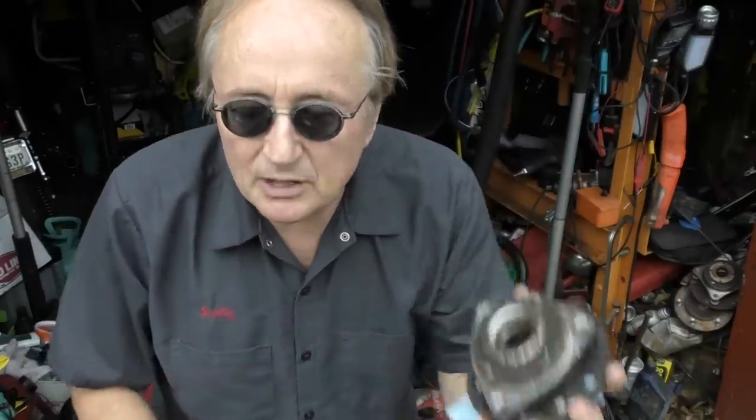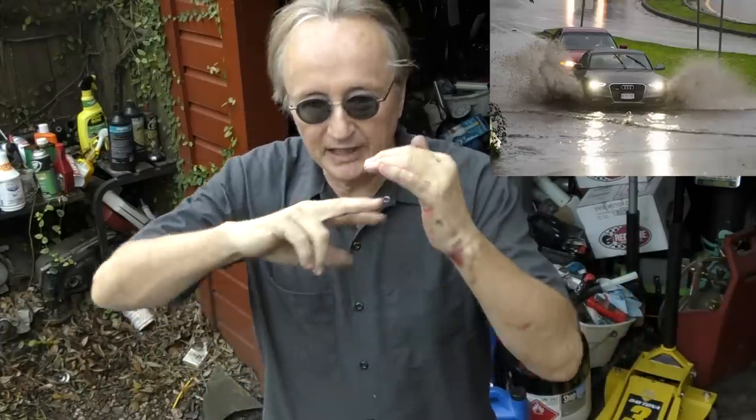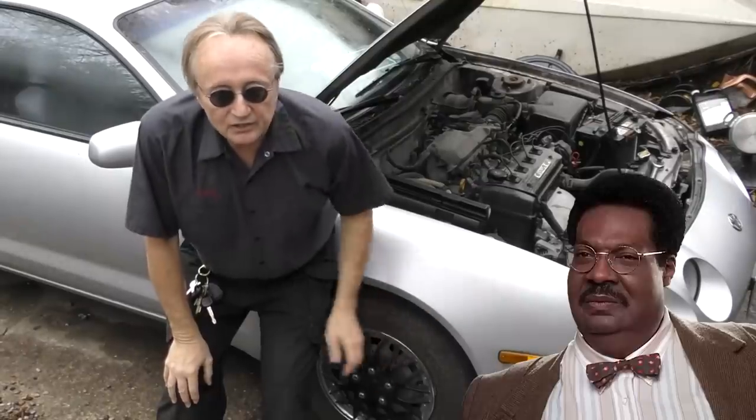The newer ones are a whole assembly, and some of these assemblies not only cost a small fortune, but on oddball cars like European ones, just replacing them can cost thousands of dollars. So of course you want to make them last as long as they possibly can. Now since they're all sealed units there's no greasing for you to do, but seals break down over time. My advice is to stay away from both deep water and especially salt water — driving on the beach by the ocean may seem cool, but you get that sea mist water and it gets inside and starts eating up your bearings.